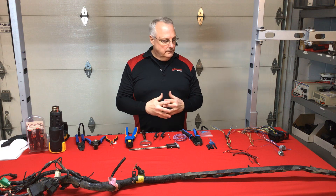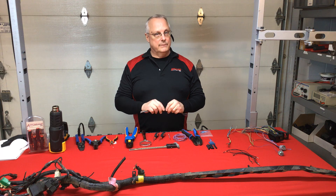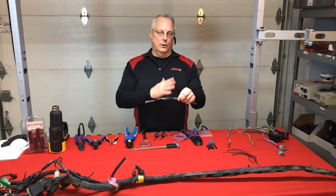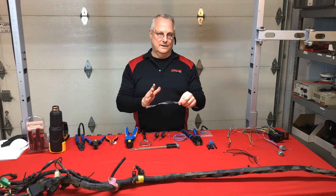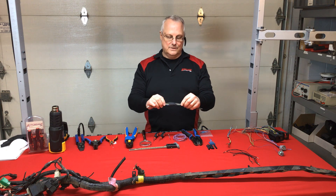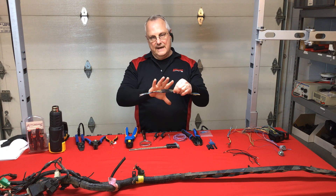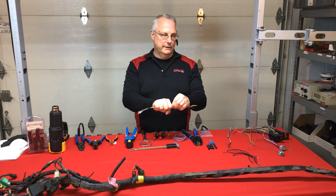What is the six wire rule? No more than six wires should be repaired in a bundle. Let's take a look at what happens when we have damage in one particular area — which is usually always the case. When we start to do that repair, we end up with a pile of splices in one area. They start stacking up on each other — what we call the meatball effect. You get a big meatball in the wire harness assembly.